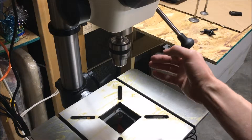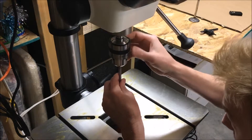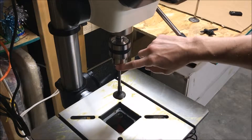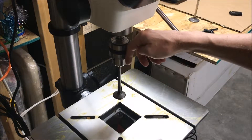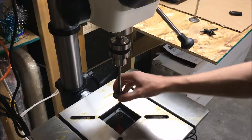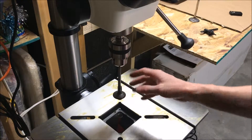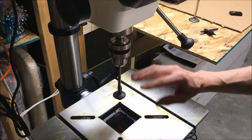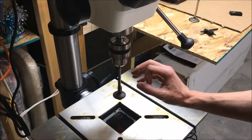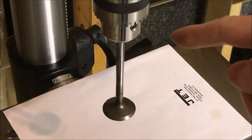And if you haven't figured out where I'm going with this, let me show you. Simply going to chuck up these valves and look for any wobble that they might have. This is one of our exhaust valves. I'm going to give you a better view here. I'm just going to spin the drill up, and if we have a wobble on our valve, we know we probably have a bent stem. If it's nice and circular, we're probably okay. I'm expecting a slight wobble in all of these, but we're really looking for a major one — that's really going to tell the tale if we have a bent valve. Let's spin up our first valve. This is an exhaust valve.